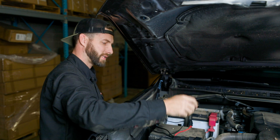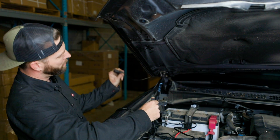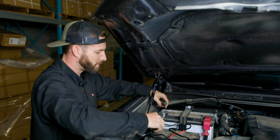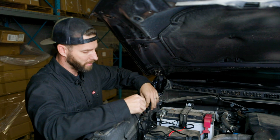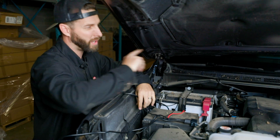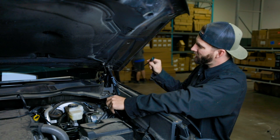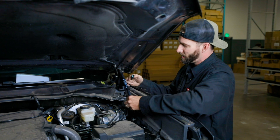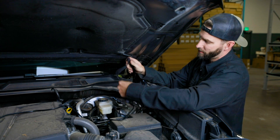With our two terminals connected, we still have our relay here. I'm now going to take my first end of my dual leg and route the wire from my pod — I like to pull it right here close to the hood bracket and bring it down. We're going to connect by simply pushing the connector in until it clicks and we're in place nice and tight. With this wire hooked up, we're going to move our other DT connector and our switch over to the other side of the hood. Like we did on the passenger side, we're going to take the lead from our pod, route it cleanly into the engine bay, and plug in our DT connector. Wait for that click — there it goes, nice and tight.